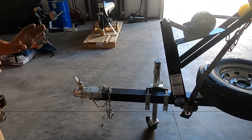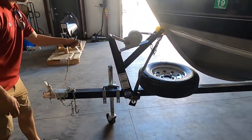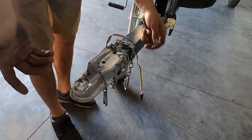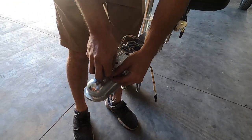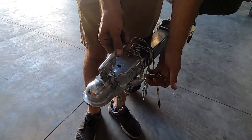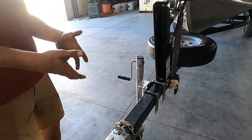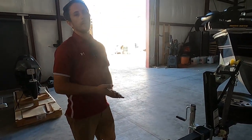It's got a two-inch coupler. This trailer does not have brakes — for this size of boat it's not necessary — and then you've got your traditional four-way plug in the back for your lights. When you are hooking this onto your truck, flip down on the latch, and most importantly is going to be your safety pin — you'll want to slide that right through there. Do not forget that. Whether you use a safety pin or go buy yourself a lock, you need to have something going through here so the safety latch can't disengage on the ball. And then you want to hook up your safety chains — we recommend crossing them so if anything does happen and it pops off, it'll hold it up from hitting the ground. Now we're going to climb up in the boat, go over a few systems inside, and then we'll be ready for the water.